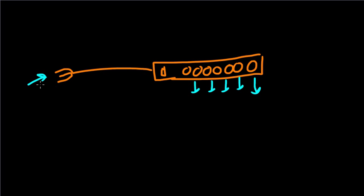I want to talk about the electrical system on the SR20, but before I can do that I have to explain a little bit about what a bus is. An electrical bus is essentially a way of distributing electrical power to multiple places from one or multiple sources. The most common electrical bus that you've seen in your house is a power bar. You've got several sockets and a power switch. You can take electrical power in to the plug and output it from the various sockets. That's an electrical bus — an input to output distribution system for electrical power.